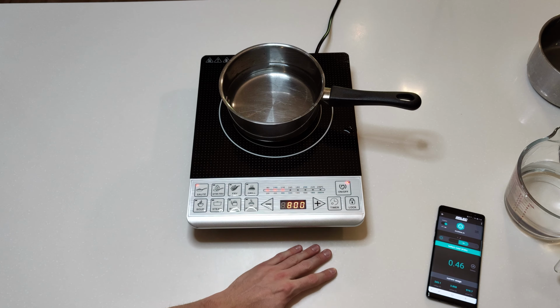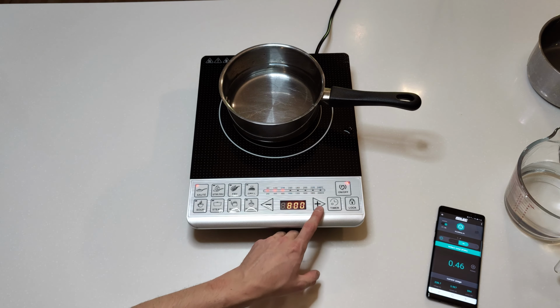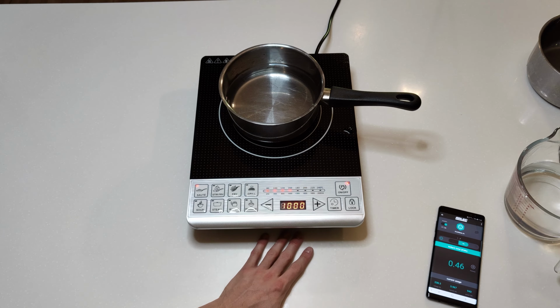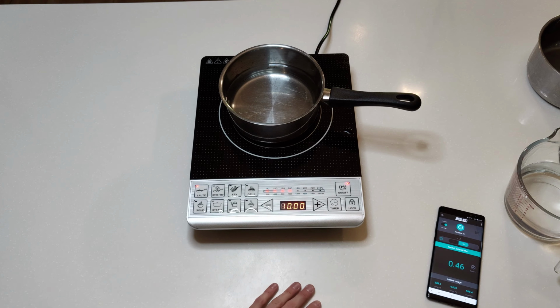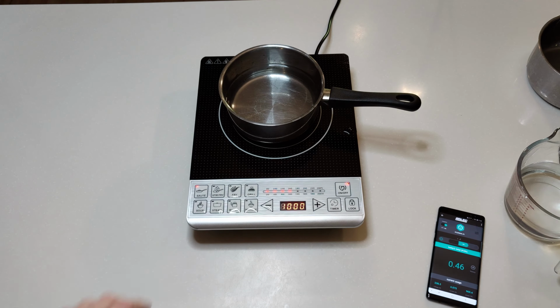Yeah, 1000 again. Alright, up again. Guessing there's a timer in this, and the timer's not hugely accurate. Alright, still at 800 to 1000 sort of range. Now we've got it set to 1000 watts. So theoretically, this should stay on, drawing 1000 watts. So it seems like the duty cycle is under 1000, and from here it can actually vary it. I don't remember if the other ones have the same functionality though. I'd actually like to go back and test them at some point. It also occurs to me now that the framing is a little bit on the wonk, but good enough. So that's consistent.